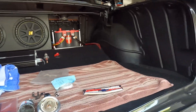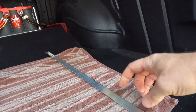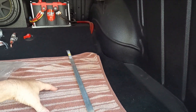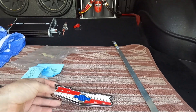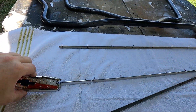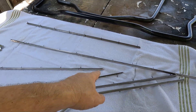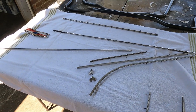I'm going to use some aluminum strap and cut a bunch of pieces to make L brackets, mount them to the body — a few up high and some down here on the masonite panel. There will be holes drilled in them and that's where the door panel clips will snap in. That stainless trim will come right up to the edge, and everywhere there's a piece of trim it's going to have a rounded corner instead of just lopped off.